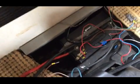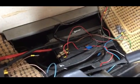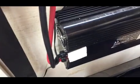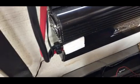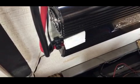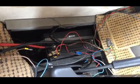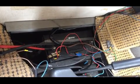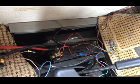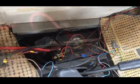And so what I'm going to do now is connect all the positive stuff up, and then that's basically everything done down there, and then I can start working on the second battery. So I think I'll bring the red cable in from the inverter, put that down onto that terminal as well as the positive. I'll plug the fuse in, and then I can pack all that up, and then that's done and dusted. And all I've got to do next is the negative side of the wiring, and that's more or less everything done, I think. And then it's a case of uncovering the panel up on the roof, and fingers crossed, let's see what happens. So next thing, connecting the positive side up.